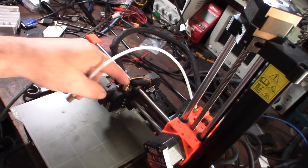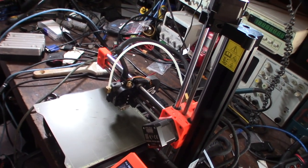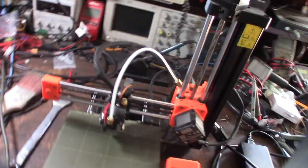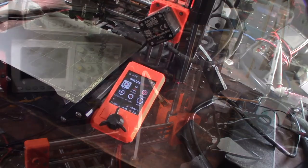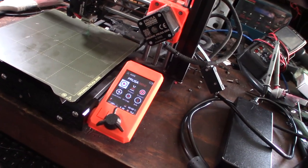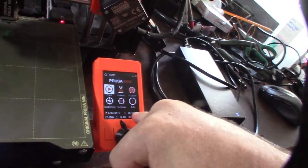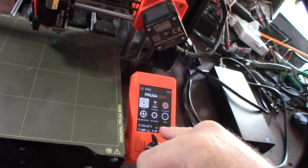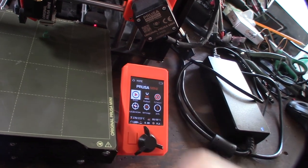I'm going to see if I can pull that filament out. I might open up Cura, create a profile for this and do a test print. I noticed that the bed is at 60, the printer is commanded to go to 215, but I'm only getting 170 here.